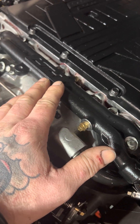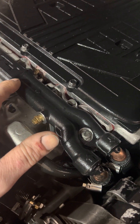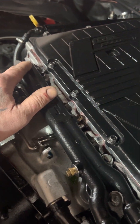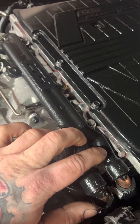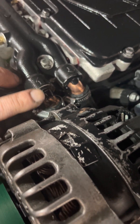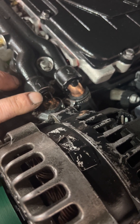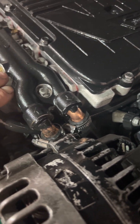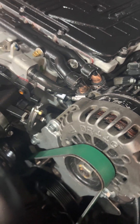Next was tackling the cooling system. I kept the stock LT4 intake. I've seen some kits online where you can just put some fittings here and there and run hoses whichever way you want. I ended up drilling out the nipples and putting some brass fittings in, then JB welded them in — works perfect, no issues there. That was a tough one to tackle just because I kept the truck-style LSX belt upgrade and there was zero clearance for anything.